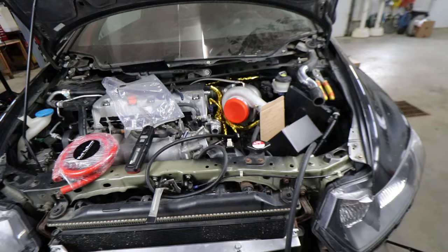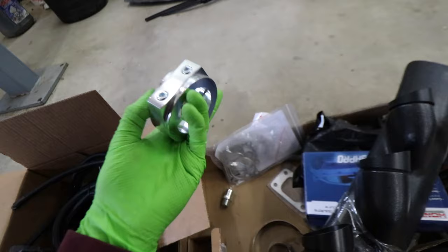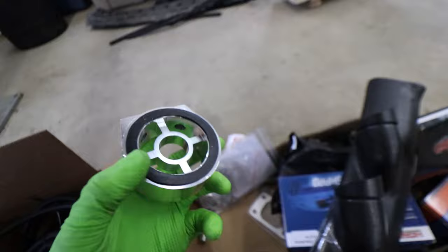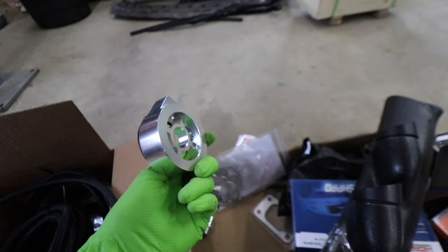So I'm going to head to the store right now and pick up all this stuff. One more thing I want to mention — why am I buying all these fittings if the CX Racing kit comes with an oil filter sandwich plate? I am not a fan of oil filter sandwich plates. You can see all the scratches and that the sandwich plate already has. So if we want to run the oil temp sensor, maybe one day. But I would much rather just get adapter fittings for the oil pressure switch so it's all threaded, all sealed, and we're not going to have any leaks.